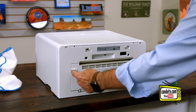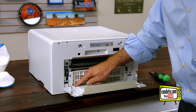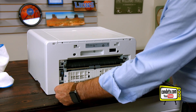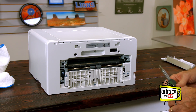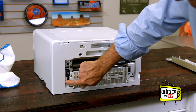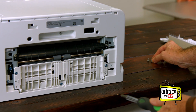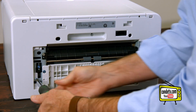First step is we're going to open the back cover of the printer and we're going to remove it. Now if you look right here, you're going to see that this side is a little bit different from this side. This side actually compresses. So to remove this plate, we're going to push just a little bit so that this compresses and this comes out. So we've got this out of the way. Next, we're going to remove three screws from the back — this screw, this screw, and the middle screw. We'll start with the middle screw first, and then this screw over here.